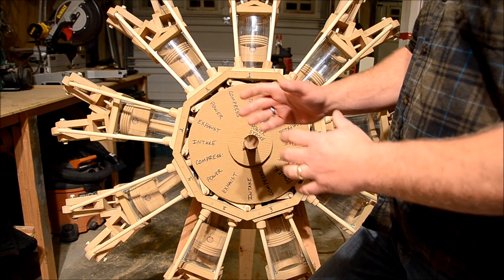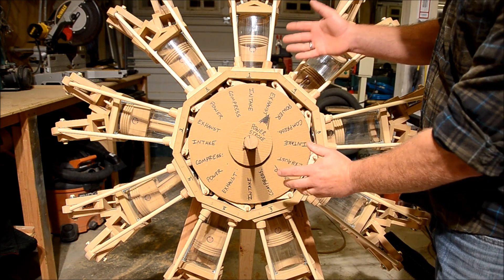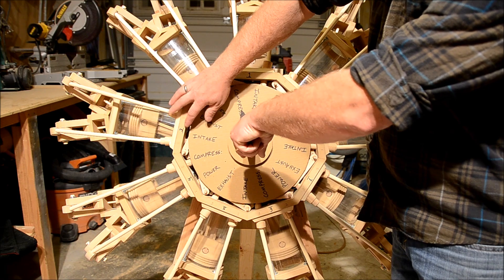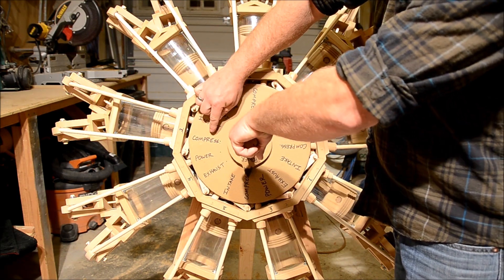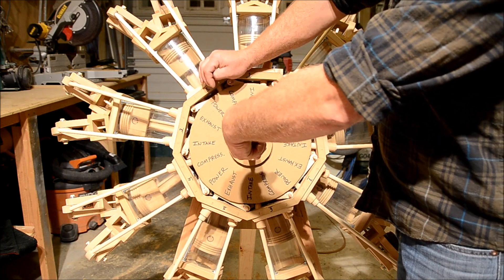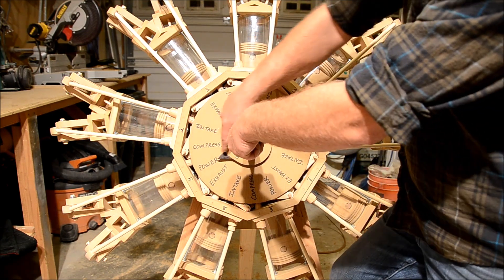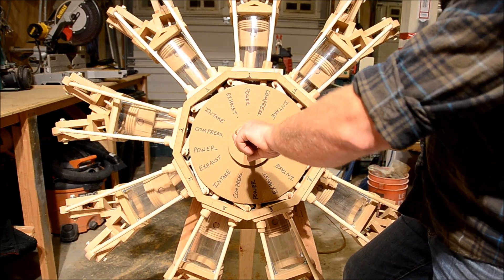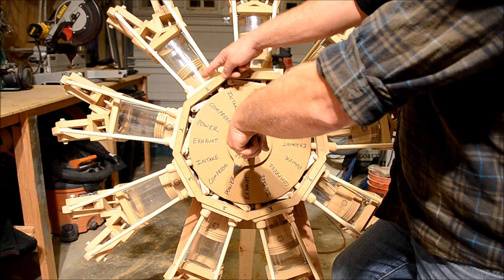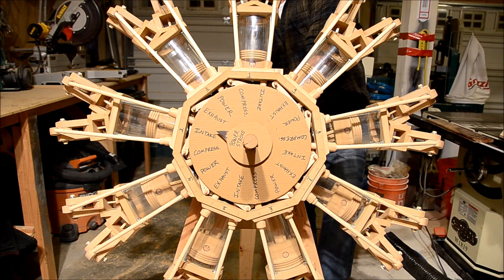It's hard to keep track of which one's doing what, and the radial is no different — so hopefully a little cardboard cutout will help. We can look at number three: the piston is coming down on an intake stroke, going up on compression, down on its power stroke — which is indicated now — then back up on exhaust. We can watch the power stroke alternate all the way around: number two on power stroke, number four, number six, number eight, number one, number three. Then we can see number two coming up on compression — you can watch everything going on. I'll spin it again slowly from the back so you can watch it.